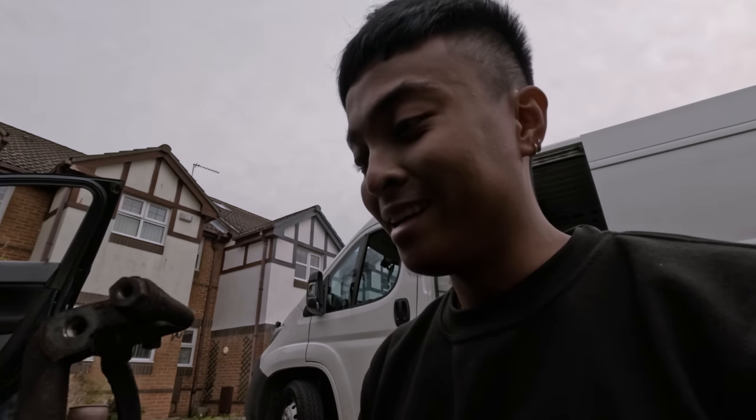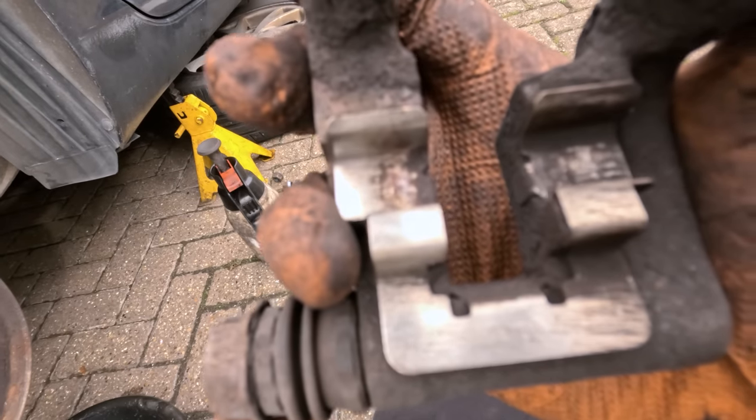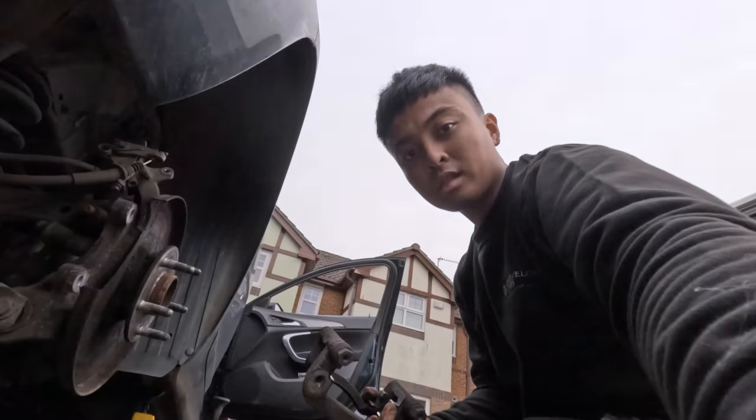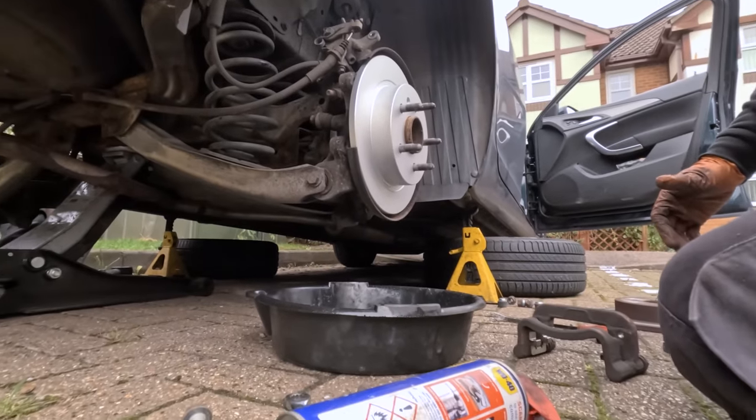Please believe me — don't use cheap parts, mainly if you're in trade. Unless the customer supplies them, don't use cheap parts. And here's another thing — I used copper grease on this, and as you can see the remnants are still there. The grease eventually runs out and then the copper itself causes the brake pads to seize on the sliders. That's another proof — stop using what's not meant to be used. Follow instructions, follow new technology, follow new findings.